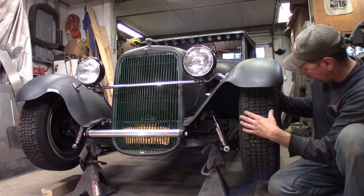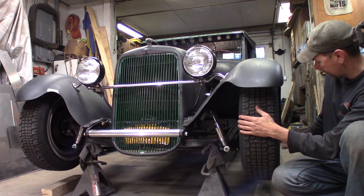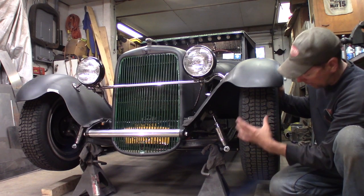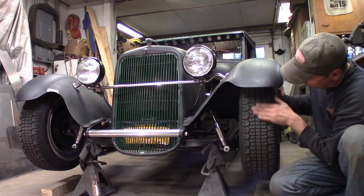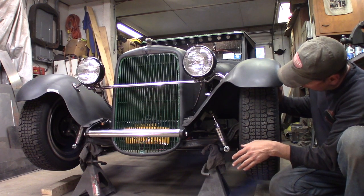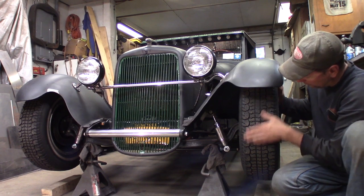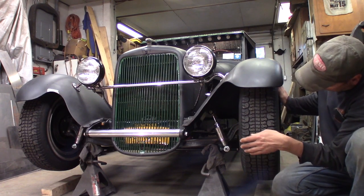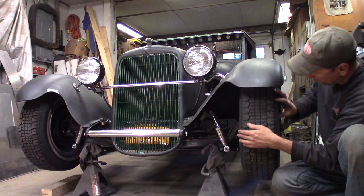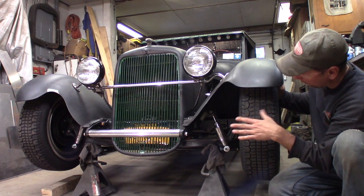I think that's the only place that's hitting right now. These are 15 by 6 aluminum dish mags — late '70s Chrysler dish wheels. I'm not opposed to going to a narrower tire; they'll fit on the rim. These tires are kind of old and they also flat-spotted when I was doing burnouts at a hot rod party. With the line lock I dragged the front tires and that actually scuffed them and flat-spotted them, so they have a flat spot and they shake a little bit on the road.